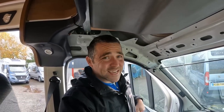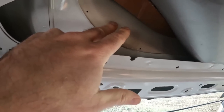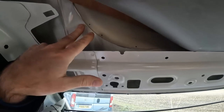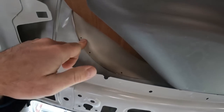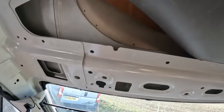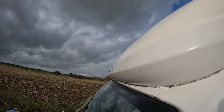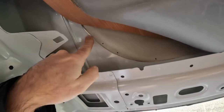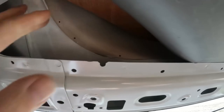I've found where the water's collecting, not where it's coming in yet. I've had to drill some exploratory holes. This is the headliner — it goes the full length so you can't actually get it out, because the hole is cut in the roof and then that is sealed before the outer roof cap goes on. I can't do anything with that easily. This piece is all basically full of water, but because the headliner is sealed and completely waterproof, the water was all collecting in there so I couldn't see it.